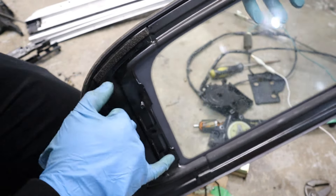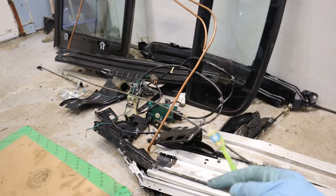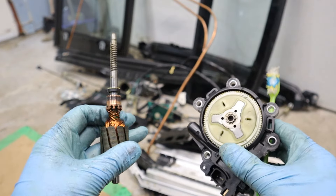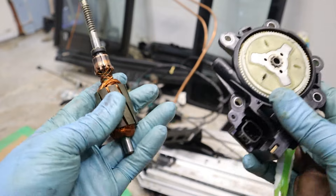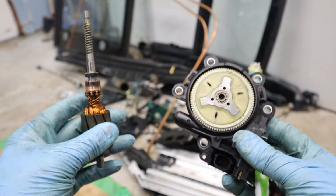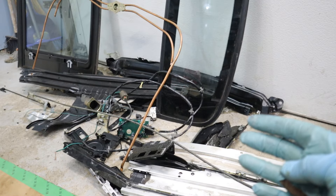Finally, we have the glass — the most important part. It's your typical automotive tempered safety glass; it's a shame this one isn't tinted. I really like how most sunroofs are literally bolt-on, so if something does happen it's very easy to replace. Technically speaking, this is actually a moonroof because it's a glass panel that slides into the body — a sunroof is a hard panel that slides outside the body. And that's pretty much all the components inside of your car's sunroof and how it works. So the next time you open your sunroof on a nice warm summer day, make sure you think of all these components that go into making it work. Make sure you subscribe if you want to see more videos just like this one.